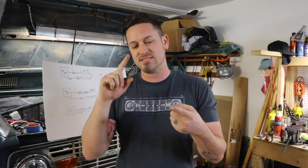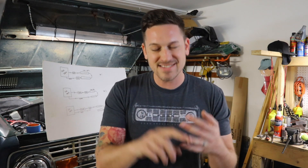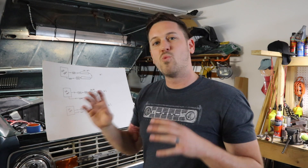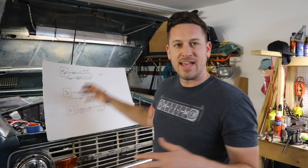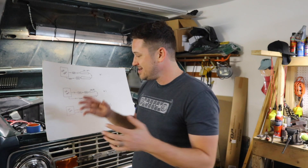I hope that was helpful. The things to remember: figure out if you need a bypass regulator or a normal regulator; make sure you get one that's EFI or carbureted, or like mine that can do both; make sure you get the right fittings; use manifold pressure on the fuel pressure regulator if you need it; and make sure you set it up the right way for your system. If you have any questions, let me know in the comments below. Thank you guys so much for watching. I'm going to install this thing and fire up the Edelbrock. I'll see you guys next time.